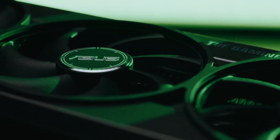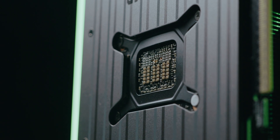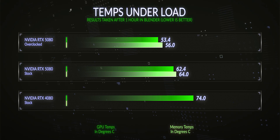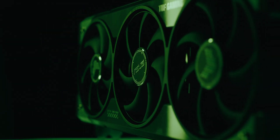What I managed to get out of this card was just over 3,000 MHz on the core, stable through everything I ran - that would be 24/7 stable for your average gamer. The memory clock speed, I could add 550 MHz to the memory speed, which is a fairly solid result and very similar in terms of maximum frequency to what I was able to pull out of the 5090. This resulted in 2.5% more power draw, or a power draw of 326 watts, which is very similar to previous generations. With the fan set to maximum speed, I managed to pull down the maximum temperature of the core to 53.4 degrees C on the GPU, and the memory temperature dropped to 56 degrees C. With better cooling - say you water block the card - you'd be able to get even better frequencies than the 3,000 MHz achieved here, showing the card can scale with cooling.